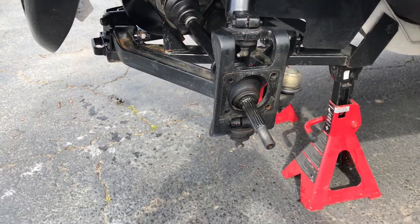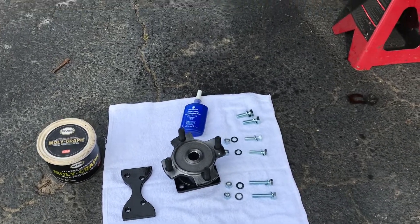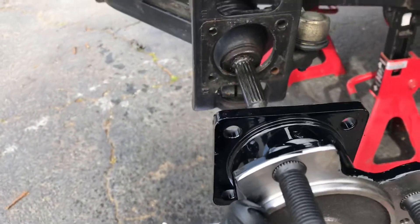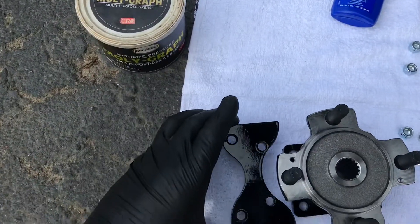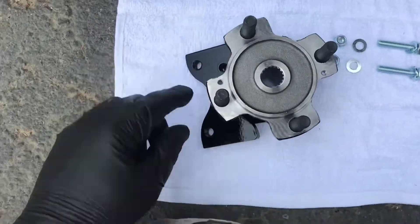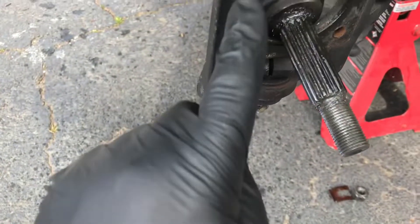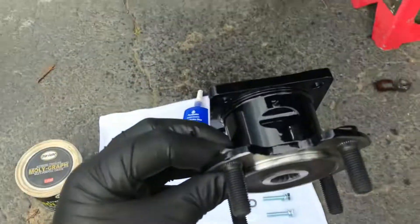We got the stock drum brakes removed and now we have the NEV Accessories hardware kit. I just want to go over a couple of things before we start. The hub orientates long ways — it's tall this way — and that coincides with the bow tie, so it only works one way. If you go one way it lines up; if you go the other way it doesn't. When assembling, we're going to use the longer bolts at the front and the shorter bolts at the rear. I'll bolt this up and explain it a bit better in a second.